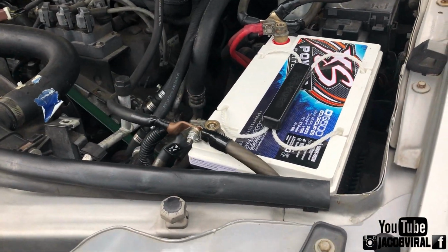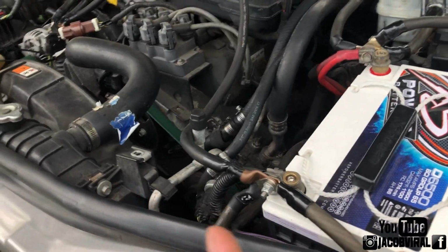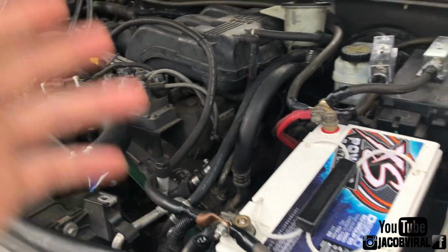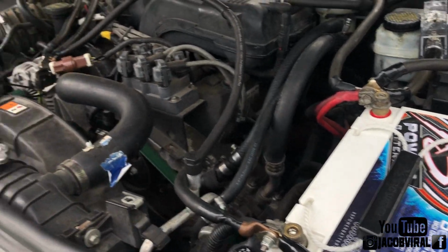I'm not going to have the best voltage. I'll probably drop into the mid 12s whenever it's at idle, when my alternator's not revving. But if I'm revving my alternator and it's bringing good supply on a high output alternator, I can keep mid 13s, no issues, as long as I'm not clipping and it's a clean signal. So nothing wrong with that. It could always be better. You can also ramp up and get into the high 14, 15 volt range with alternators too.